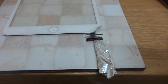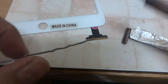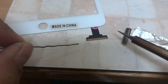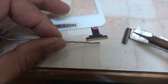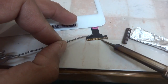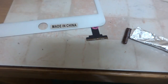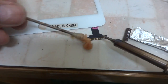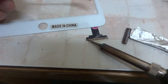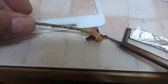For the fixation of the new board or panel, we have to clean and solder the pads. I will tin the pads so they will connect properly to the board. I apply some flux because without flux it will not work. I am going to apply flux over all these pads so that they are all tinned.